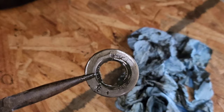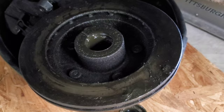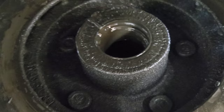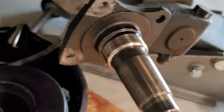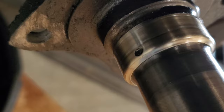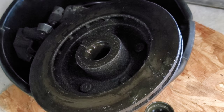You can see the bearing right there — pull all this off and then we'll replace the gasket on the back. Once you take it off, get a rag and clean off all the grease on your spindle. You can see the blown out seal and grease that went flying everywhere on the rotor. We're gonna take that seal out on the back, clean this up, make sure the seal surface is smooth with no burrs, and check that the spindle isn't damaged. That little hole there is where grease comes out — we'll put a zerk fitting on the front and pump grease in through that.